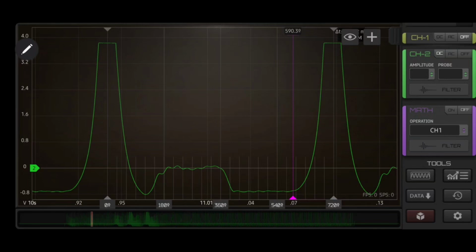And according to the signals I was getting from the Hantek on the sensors in the vehicle, when I was matching it to the Rotkee diagram, or the Rotkee library waveform that I had gotten, I was looking at the signals I was getting from the sensors, and then I was unplugging them. I would see which one I thought was advanced, and I would unplug that from the car, and that was the same information I was getting on these scope waveforms.